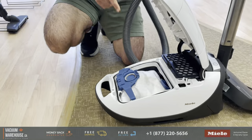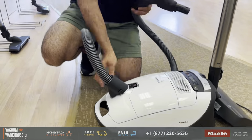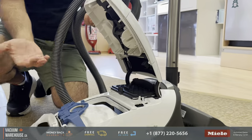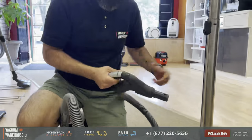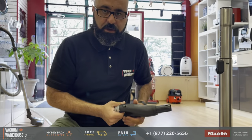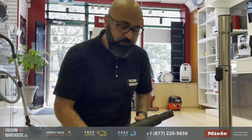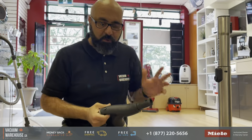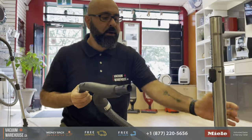A full bag also affects the reading because the airflow travels through the bag to the motor, and the indicator is just measuring that airflow. For people asking: when I start vacuuming, the indicator goes all the way up and down and I don't know if the vacuum is working right or wrong — the vacuum is perfectly normal. All canister vacuums, especially bagged vacuums, have this and it does go up and down. That's just restricting the airflow, so don't be worried. But if it's a new bag and it's still doing that, you've got a clog somewhere in the hose or at the bottom on the floor head.